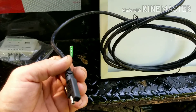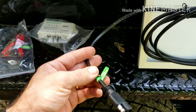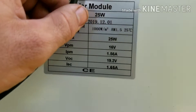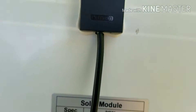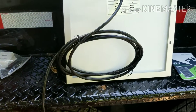What we're going to do is cut the plug off, strip it back, and solder the wires back together so that we only have to drill one small hole. You can see right there — positive, negative, brown and blue. So let's go ahead and pop a hole in the front of that trailer, cut this wire off here, and get this thing mounted.